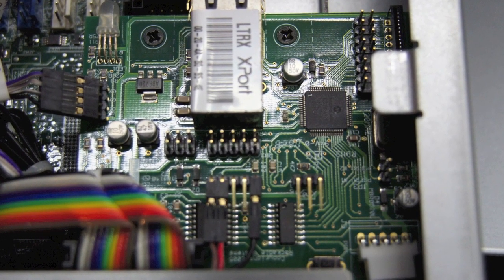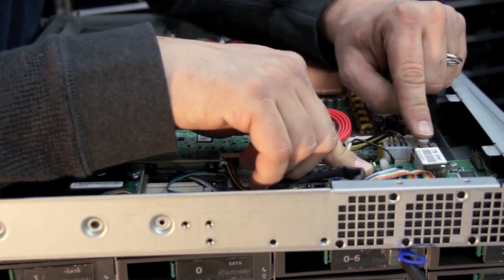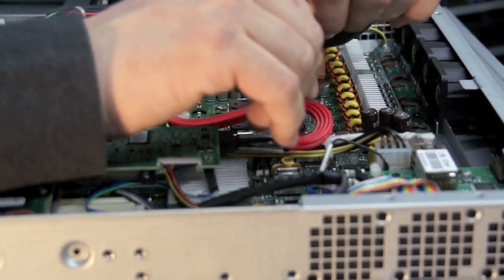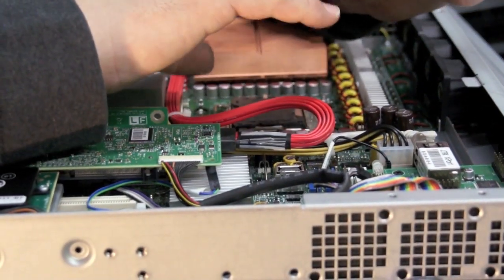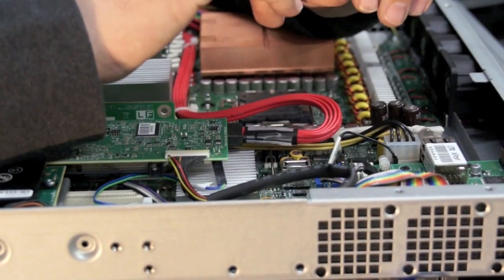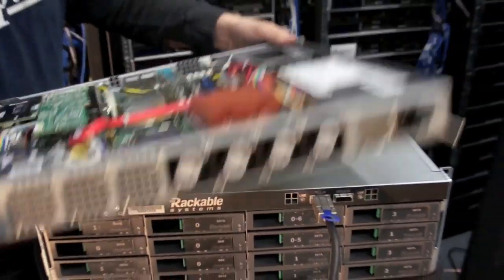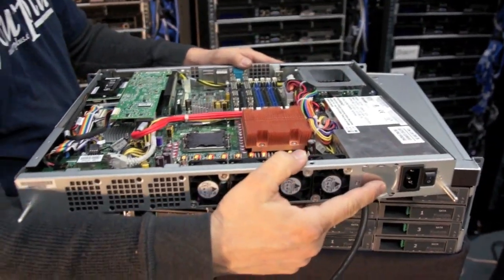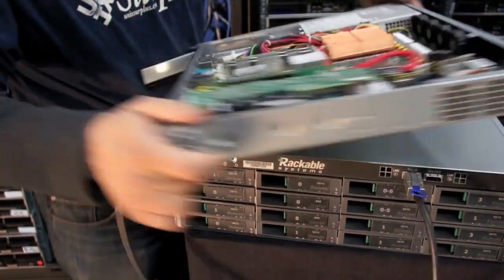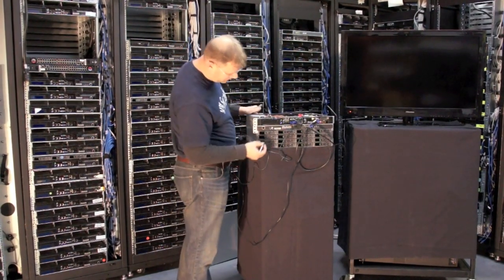Roamer management card. This Rackable Roamer Ethernet management card boots off of DHCP, gets you an IP address, and it'll give you basically web services or telnet or SSH for serial console on the system board, or for remote power management on and off. The system runs on AC power, 110 or 220 volts, so you folks in Europe will have no problems working with this machine.